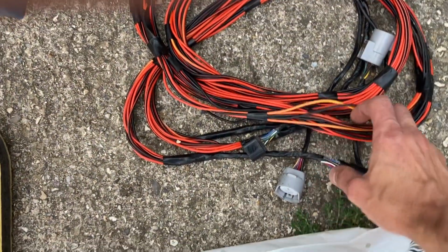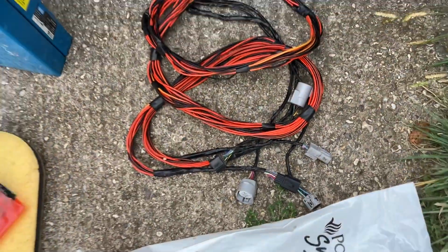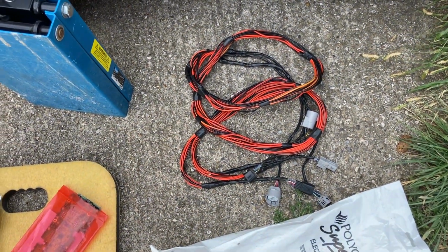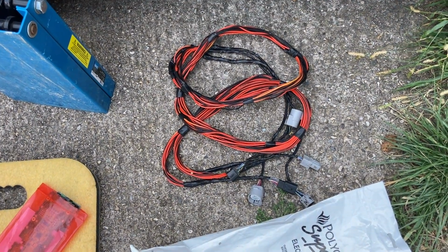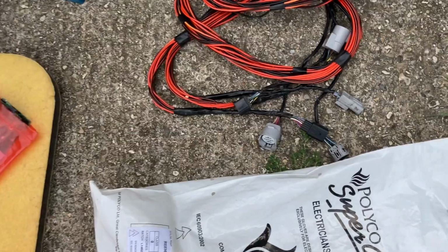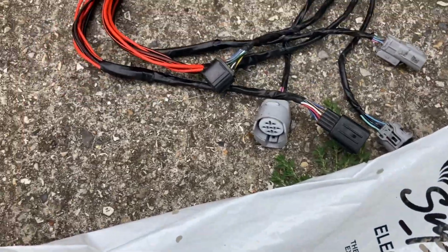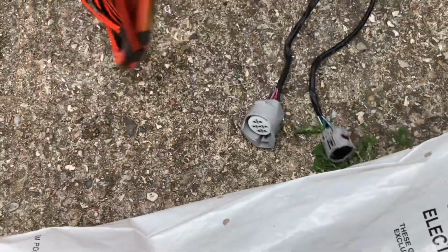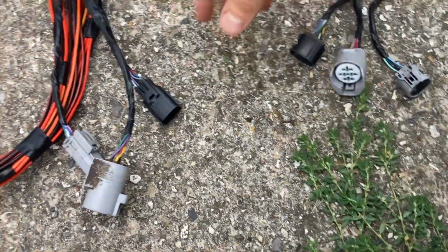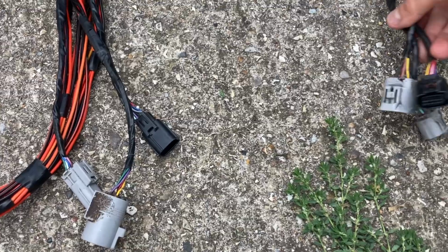And this is a lead I made up specifically for these cars. Because I'm working on the floor, it's a pain to push the battery and lift it up and get it plugged in and then see if it's fixed, especially if you test different repair methods, different stuff like that. So I basically made up this lead. I've got the connectors off a scrap battery pack and the connectors off the car side, and I made up this couple of meter lead.